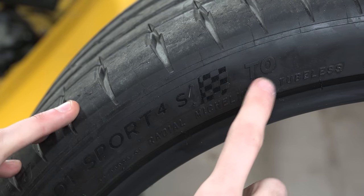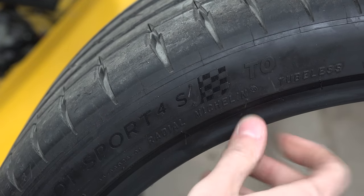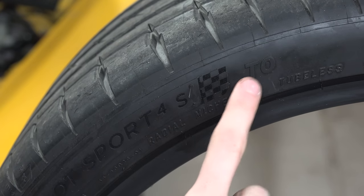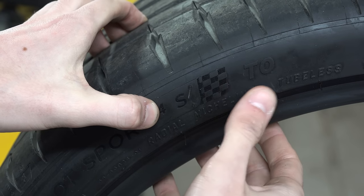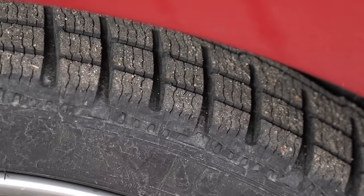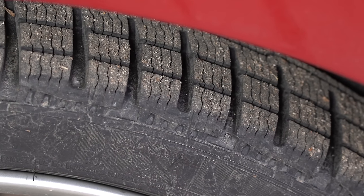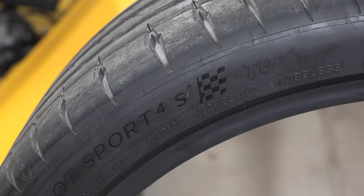You may also have tires unique to one specific vehicle. The Michelin Pilot Sport 4S is a generic tire used on many vehicles, but this TO marking indicates it was built specifically for Tesla — for the Model 3 Performance. There will be different labels for different vehicles. For example, you may see NO indicating a Porsche tire. The winter tires I actually have on my Tesla are marked NO — designed for the Porsche Cayman GT4 — but they happen to be the exact same size and load rating I need, so they work great on the Model 3 as well.